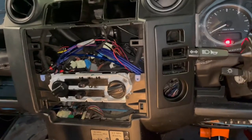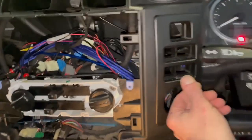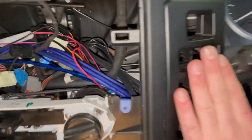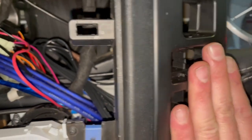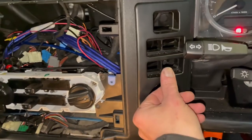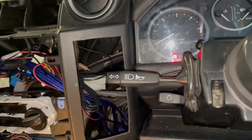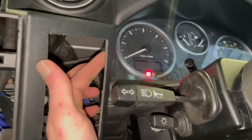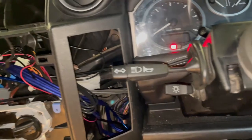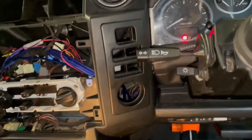That was nice and easy - got the steering wheel out of the way so we could get that cut in there. It's pretty much set to go. The only thing I don't like is this one is over-curved compared to the dash, so I'll have to just pin it back. There's a little gap I want to close up. I could heat up the plastic and flex it a bit more, but I think I'll just hold it in position when I'm epoxying it. You should end up with a cut like that - then just smooth off the back edge so we've got somewhere nice for the epoxy to sit. Another piece of this puzzle done.